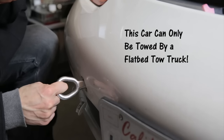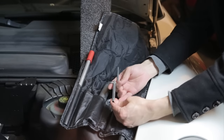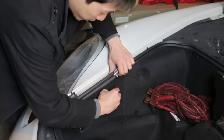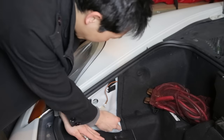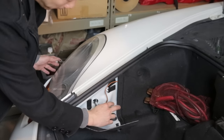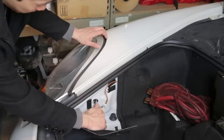After the eye bolt goes in, you're ready for towing — they'll put a hook there and pull the whole car up into the tow truck. Now you'll wonder what this weird contraption is for — it's actually for opening up your headlights. Pull this panel open like this to reveal a little rubber knob. Pull that off, then insert the tool and turn it clockwise. It'll snap, and as you rotate it more it'll push the headlight out.